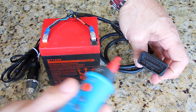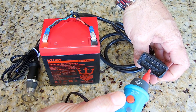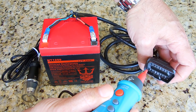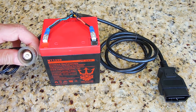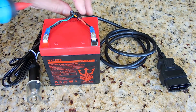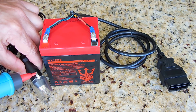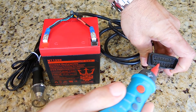Looking at this plug, it goes 1 through 8, then 9 through 16 — pin 16 is right over here. That pin is connected to the positive, so identify which wire that is, connect it to the tip here if you choose to include that, and then connect it to battery positive. Here you can see yellow and orange — those were pin 4 and pin 5. They are soldered together and go to the battery negative, along with the negative from the side of this plug.